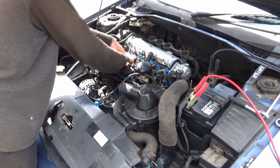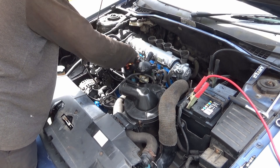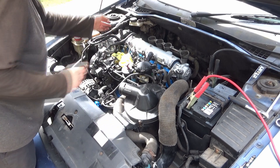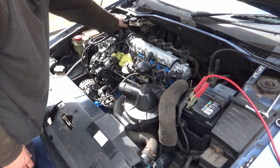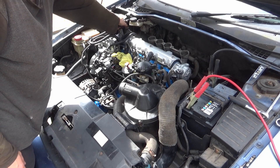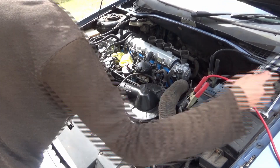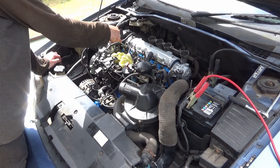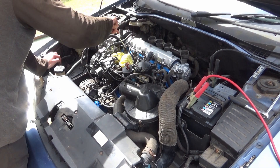I'm putting an old t-shirt down there to soak up any diesel spillage. We've squeezed the prime bubble to the point where we can't squeeze any more out of it, so that is primed right up. Now we need a 17 mil spanner — crack this one loose. Crank it for us a couple of cranks, Ian.